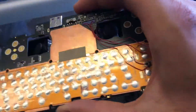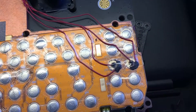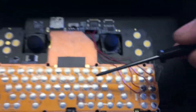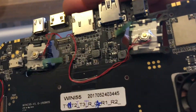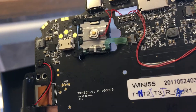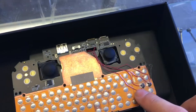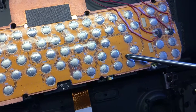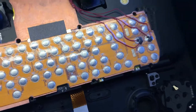That's just how you do it. There's no programming involved or anything like that. Basically the way this works is: you have two wires right there — one wire on the middle one, the other wire on the outer ring. Then one of each wire connects on each side of a tack switch right there. See that? So basically you're now moving the button, so to say. The button — the tack switch — is no longer here. This is how a tack switch actually looks like on the inside. This part right here — that's where you get that sound.